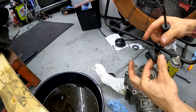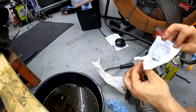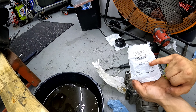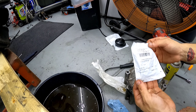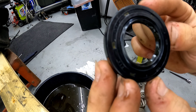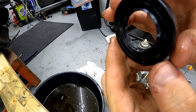Two broken seals — get the new ones. The part number is 705-501-556 oil seal — it's the same one for both sides. I'll show you real quick on camera: you see there is grease in there? Don't wipe that off, please. Keep the grease in there.